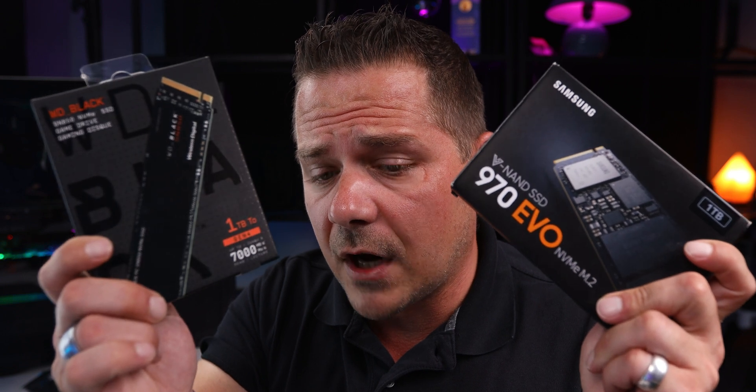Take a step back. When you're looking at buying one of these drives versus the other — Gen 3 versus Gen 4 — you're going to ask yourself: what am I using it for? Now clearly, a faster drive will be overall faster. But in the case I'm showing you here, some of the stuff is similar when switching into Gen 3 versus Gen 4. And when we're comparing something like Adobe, where I'm pulling all this data in and using certain functions, Adobe will not be using the top capabilities of a Gen 4 drive.